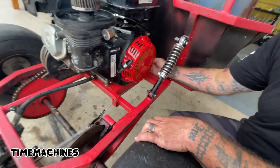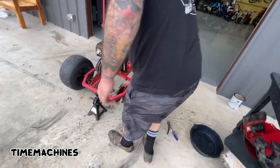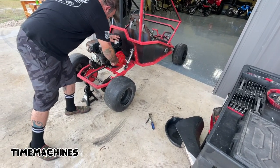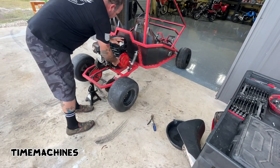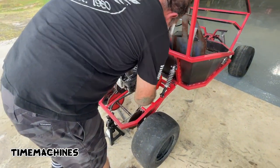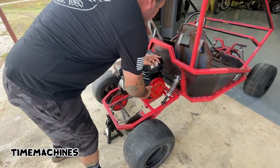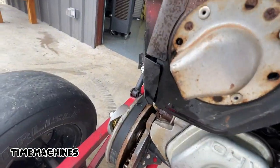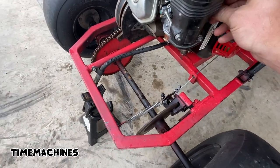Jiggle these wires. Flick them, flick them, flick them. Break the pull cord. Gosh, you got compression, dog. Oh, you know what? Let's pull the plug. I bet you it's hydrolocked with water. Hold on. Yeah, let's pull the plug. It's turning over too hard. Oh, look, it's hydrolocked, bro. I tried to pull it hard enough to get the water through the pump. Exactly.